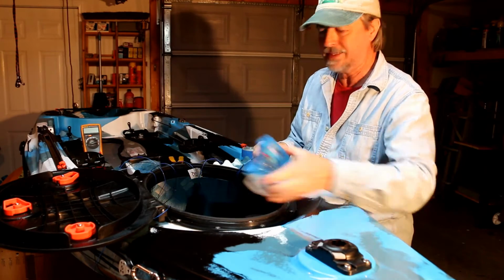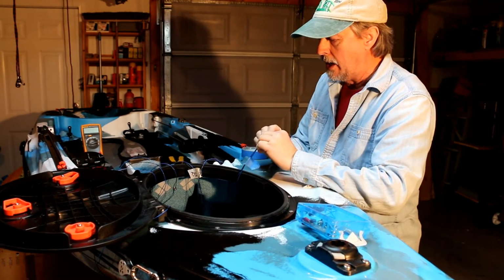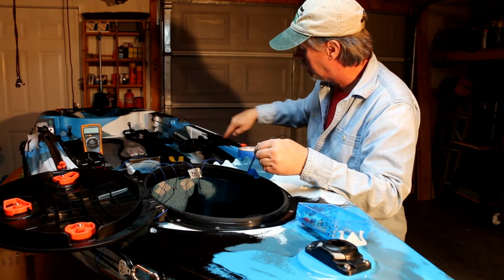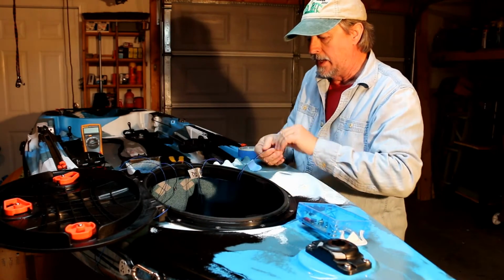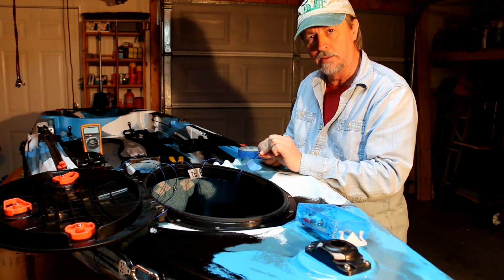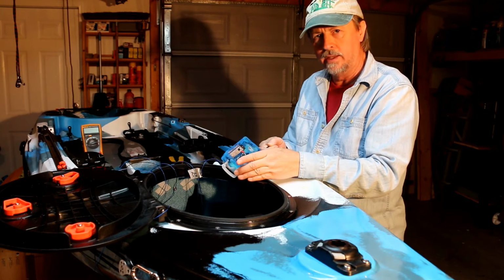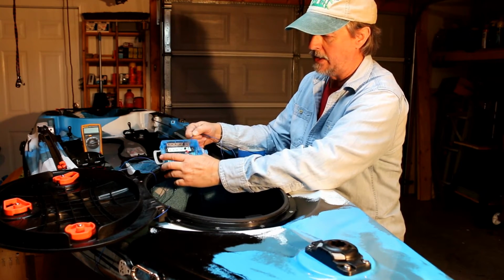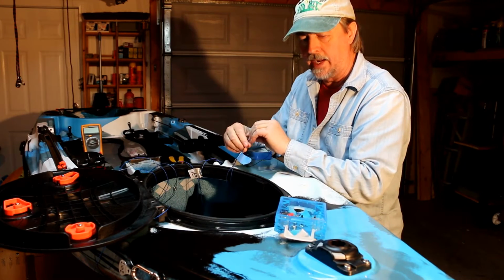Okay, with the box temporarily in place, I went ahead and pulled out the LED lights wires, by the way. While the box was in place, I pulled all the slack out of the wires from the furthest LED along the gunnel and the LED strip in the front, pulled it up out of the way so I know everything's good and snug, and I've determined about what length I need to cut these wires to, and then put the crimps, the terminal lugs on them. This will give me enough slack to where I could pull the distribution box out and do a little wiring and then stick it back in. So my idea is to bring the box up to here, do whatever wiring I need, and then take it back inside, and I'll have places inside the Kayak that I will snug up.